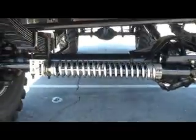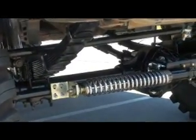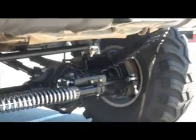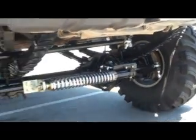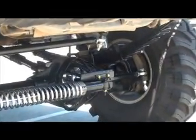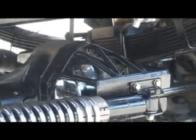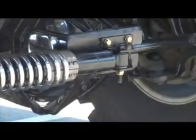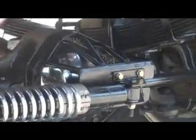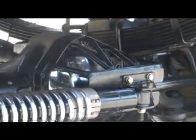As you can see, though, I got the steering stabilizer installed. That worked out great. Not where I wanted it, but I didn't have too many options because it's so long. I had to make that bracket for it right there. So what I ended up doing was just making a cage that fits over the differential cover. It's in two pieces, a top piece and a bottom piece. I made it in one piece and I cut it in half so it bolts together. I'm able to get the cover on and then the cage over the top of that and my bracket.